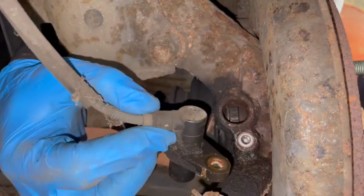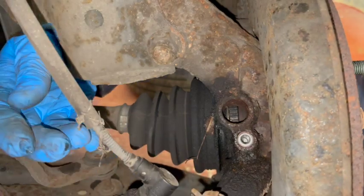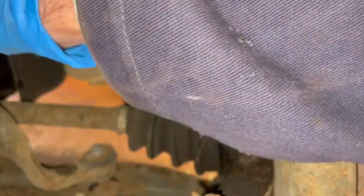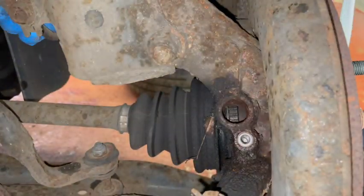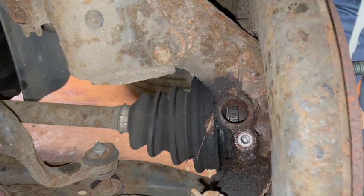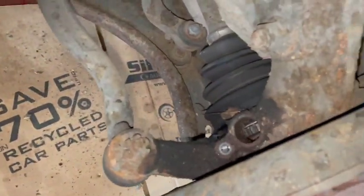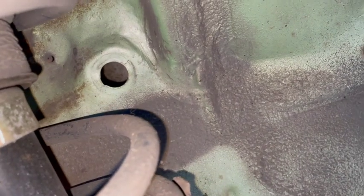You're just going to see my hand on this, but bear with me. There you go — that should pop out. Yeah, I think that's probably gone, so that's come out. I'm going to unclip it from the back. That's off. We've got the new Toyota Yaris ABS speed sensor — it's just going to be a reverse of taking it off, so plug it in there. There's a clip bit in there, hooks insert in there, goes through that hole and goes in the top side, which I'll show you when I'm there. I'll chuck it back on time-lapse and see you in a second.